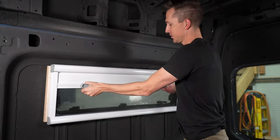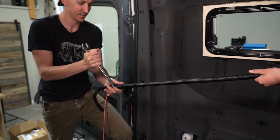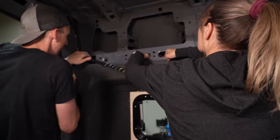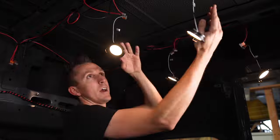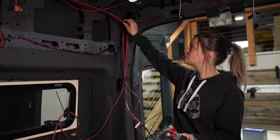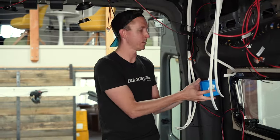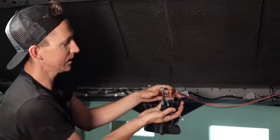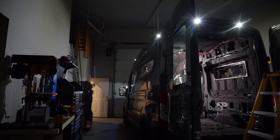After that it was time to run the wires for all of our 12-volt outlets and devices around the van. We wired USB outlets where the bed would be, puck lights in the ceiling, dimmer knobs for the lights, a three-way switch, and all of the wiring for our 120-volt outlets that would be mounted after the walls went up. We even wired some relays to control some LightForce Rock 9 lights mounted outside of the van.